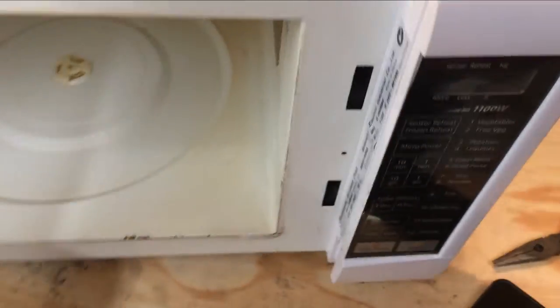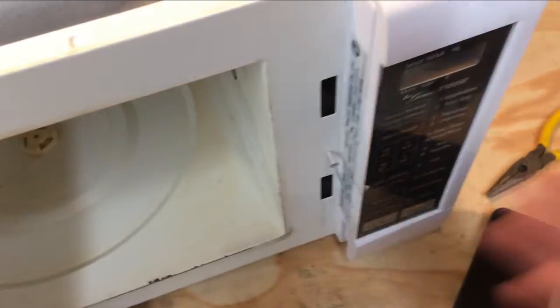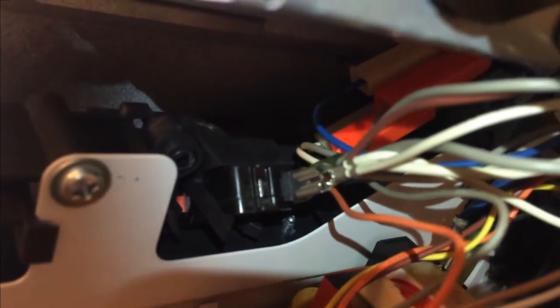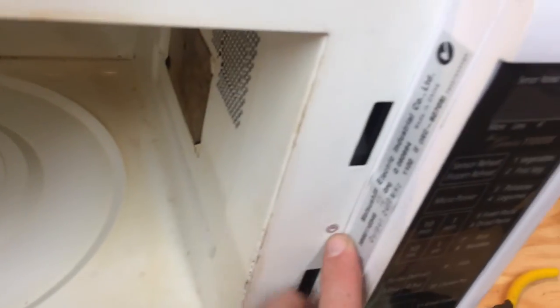Now, here's a word of warning, you want to make sure that you know what you're doing here and that you aren't putting metal rivets near any wiring. I think it's a 3.2mm rivet and I've got a 3mm drill bit. You can just see the bit of the rivet in there is clear of all switches and wiring. So we've just got a nice rivet there, and this bracket now has got no flex in it whatsoever.